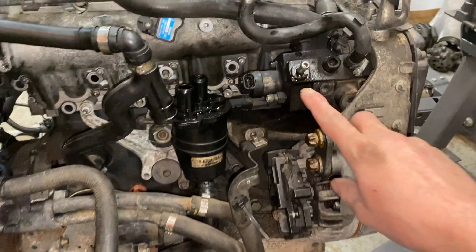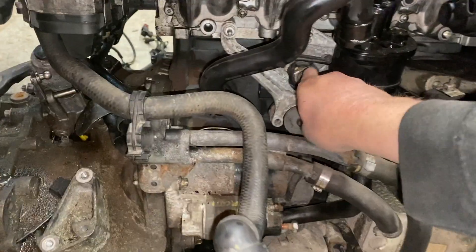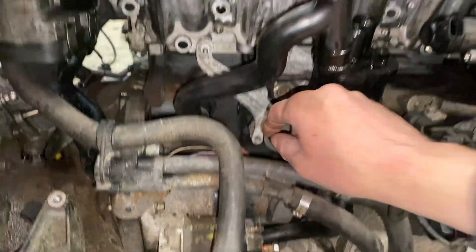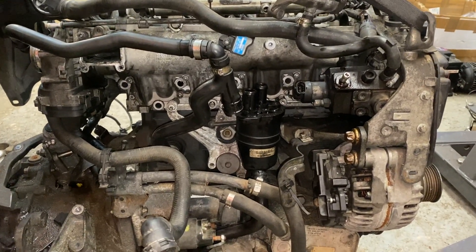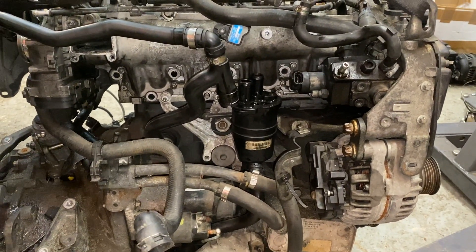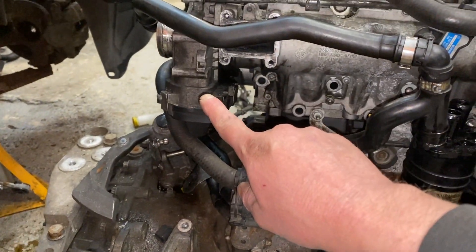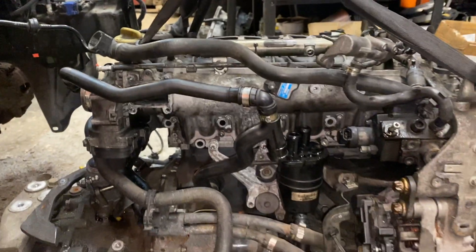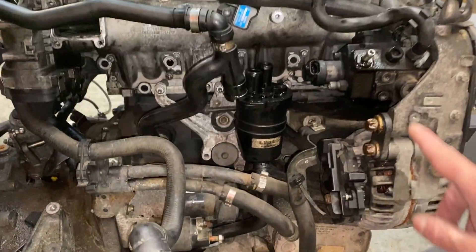The engine's now out. So this is the high pressure pump we're replacing, and this is the one we're replacing it with — also the inlet manifold. The inlet manifold comes with this flappy valve system which opens and closes valves that are very common on these engines to block up. In a previous video you'll have seen me welding up the flappy valve system, modifying the EGR, deleting the anti-shudder valve, making it a lot better and easier-flowing.